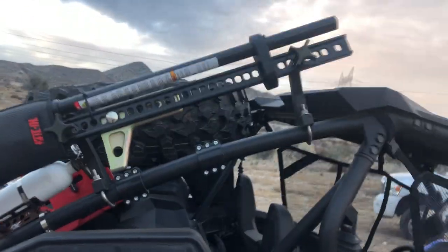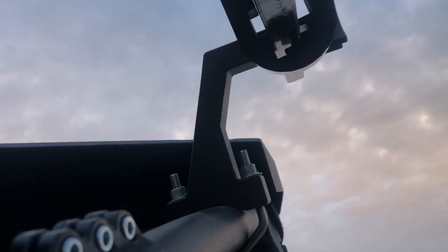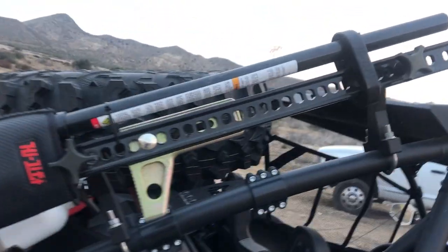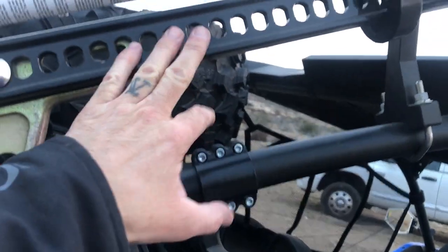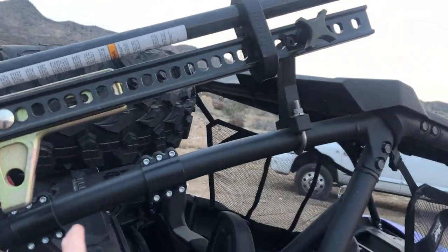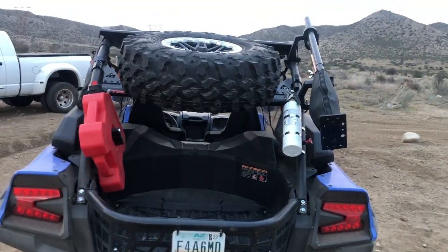The mount is a JK-style mount from one of my old Jeeps. The reason I used it is it has an angled approach, so it comes out away from the frame. I was able to push it away from the tire and fire extinguisher and it made more sense. This was originally designed to go on the roll bar behind the back seat of the Jeep JK. I liked how it made more clearance back here, kept it in line with the frame, and didn't interfere with getting the tire off or reaching the fire extinguisher.